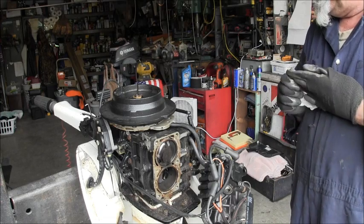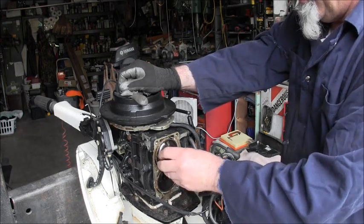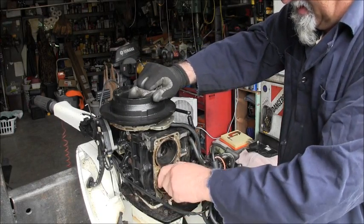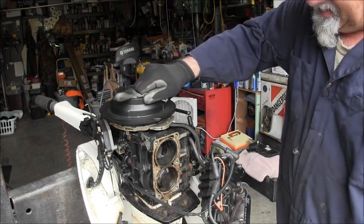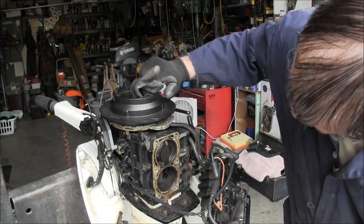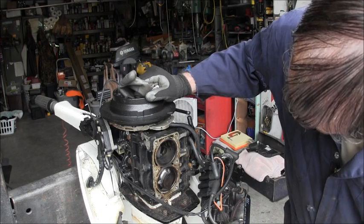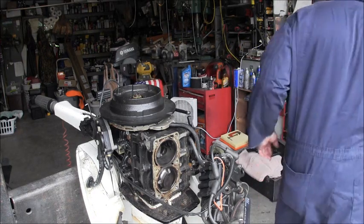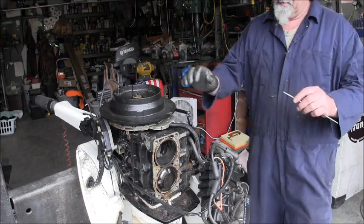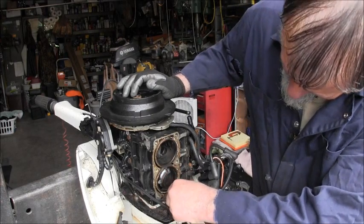Get off my glove. And the bottom we had 90 to 100. And, you know, it's got a little rattling in the bottom and a little rattling in the top. I see no cleaning of the piston crowns indicating water. Yuck in the passages.